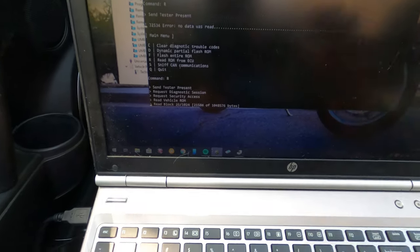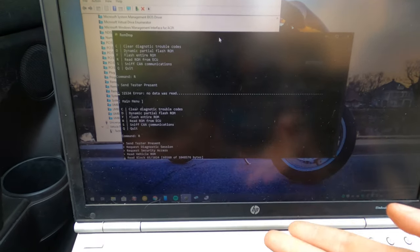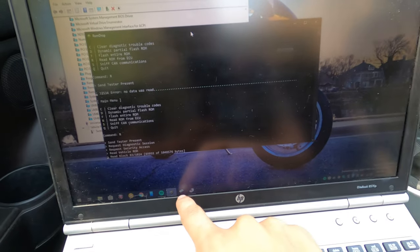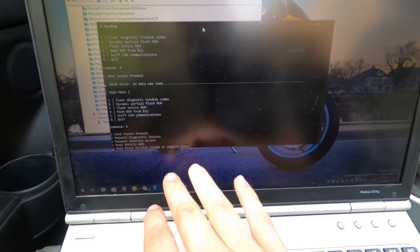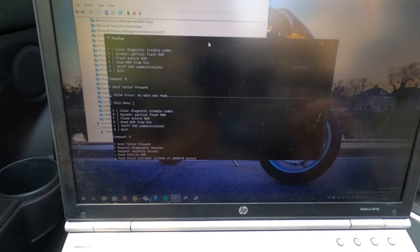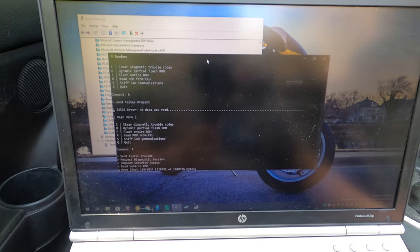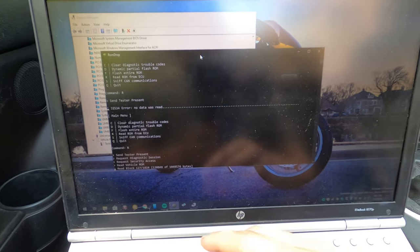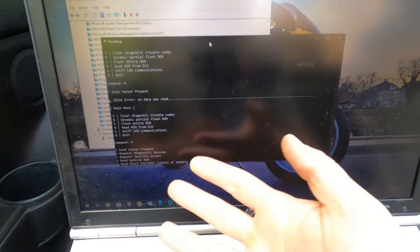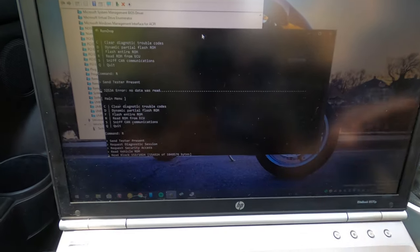I am a genius. ROMDrop is just a zip file that you can unzip and run from wherever it is, but you do need to remember where it is, because when we go into ECU Flash, there's going to be a little bit of setup that requires some of ROMDrop's files. There's a little bit of interplay between them to make sure that it's able to read all the NC ECU definitions. So when this is done, I will open up ECU Flash and we'll do that, and we can take a look at what all this software allows us to do.